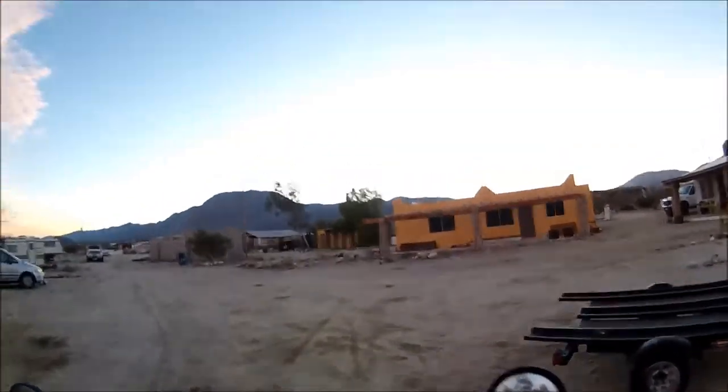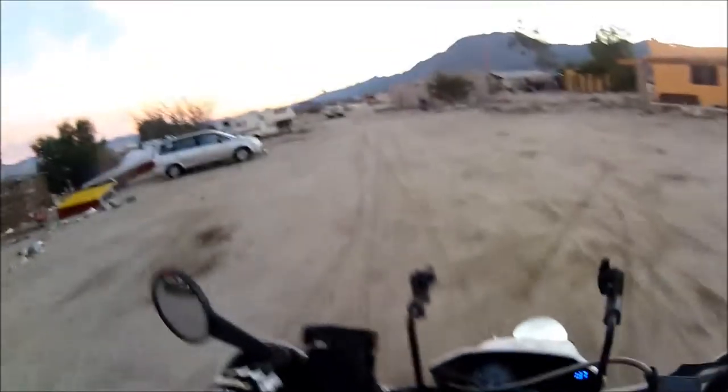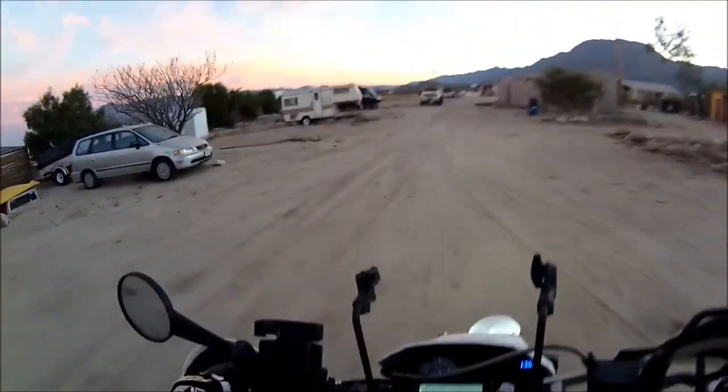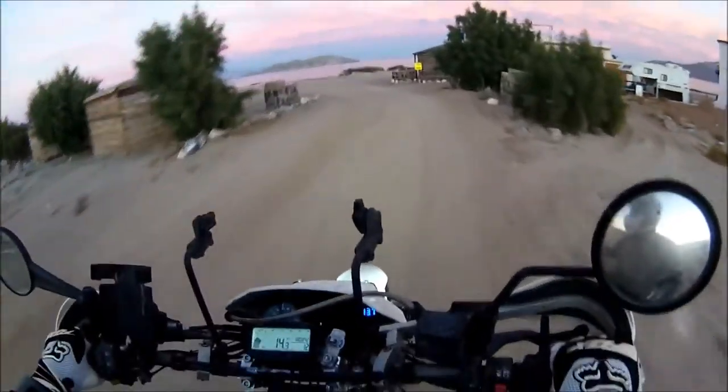It's a little knotty — not hooking up a little bit. I'm going to go air down. I've lowered the air pressure to 18 psi on both wheels. There was 30 psi in the back, so too much — that's why the back ain't hooking up. It feels like it's hooking up better now, but we'll see when we get to the beach.